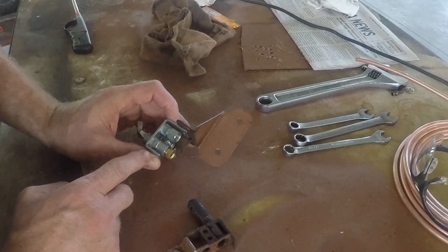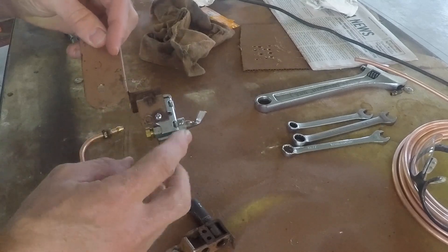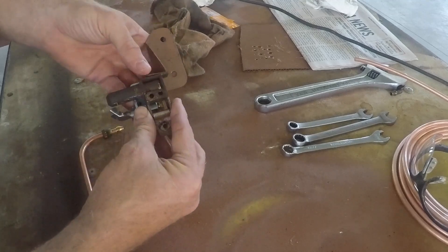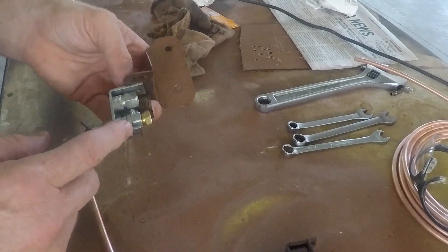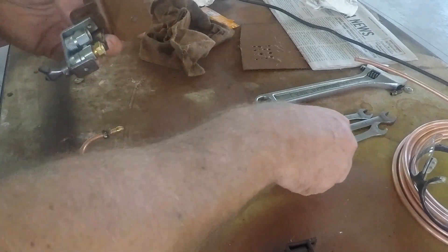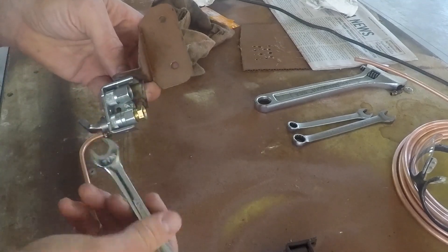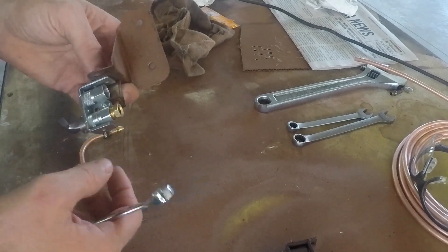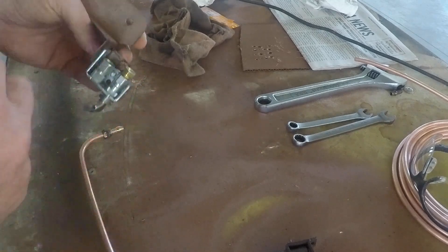I found a suitable replacement. I got it mounted on the little bracket here with half of this little drop L that was hooking it on, and have it adjusted out where it'll stick out as far as it can, because this old one was basically here — so that's about the right placement. I also modified it a bit: I sawed off one ear so it's even, that way I can get my wrench in here and be able to tighten the gas line. This is for propane, so it's supposed to have the right orifice in it already — that shouldn't be any trouble.